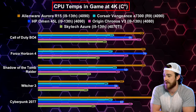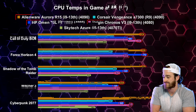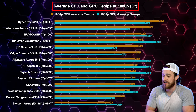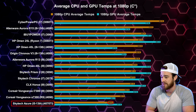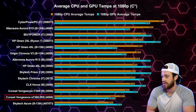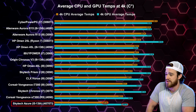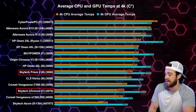These were our CPU temps for several different games at 4K. As expected, this i5 runs way cooler than the i9s and other current gen PCs we've tested — I'm pretty positive you will never have any thermal throttling here. Same thing with the 4070 Ti GPU temps, well below throttling limits. Comparing average temperatures across the last 13 PCs reviewed, this PC had the absolute lowest CPU temperature at 1080p and the third lowest GPU temps. When moving up to 4K gaming, this PC was the overall king — the lowest temperatures by far for both CPU and GPU, cooler than any PC I've ever reviewed.